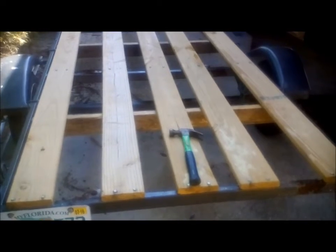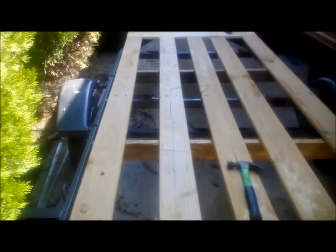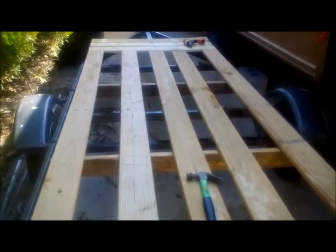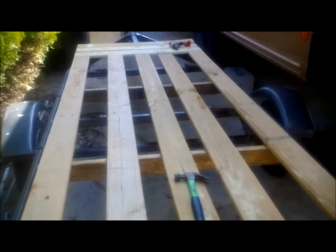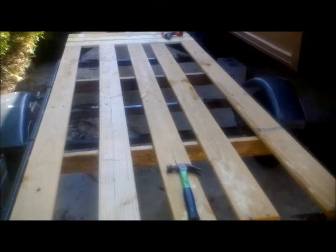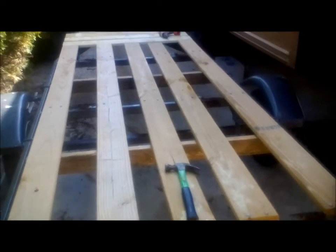But what it is, is an old boat trailer. I used 5/4 boards to raise it up past the old fittings that had the runners because they were all rusted off. I re-supported the middle, and on top of these 5/4 boards will be a layer of 3/4 inch plywood and then a layer of finished plywood on the interior after it's all put together. But this is where we got so far, waiting on batteries to charge.